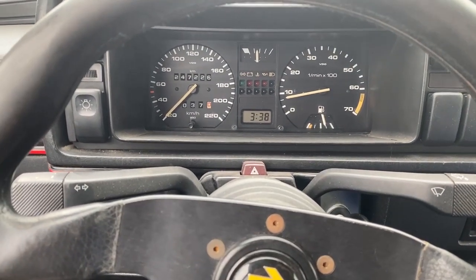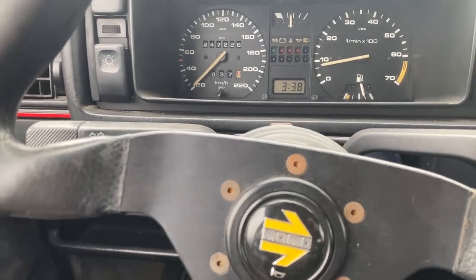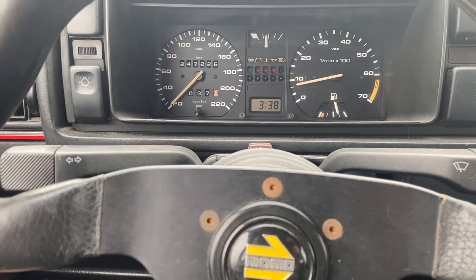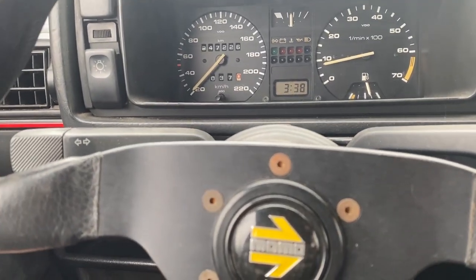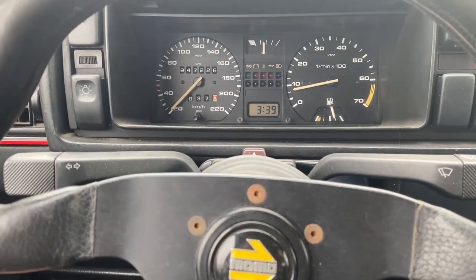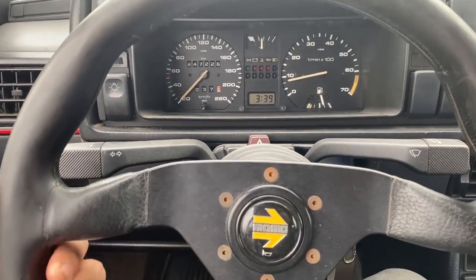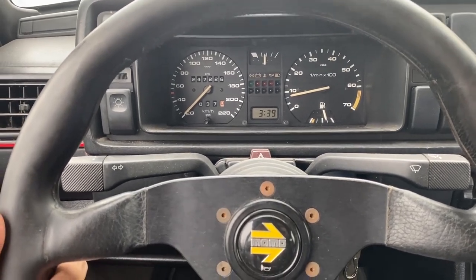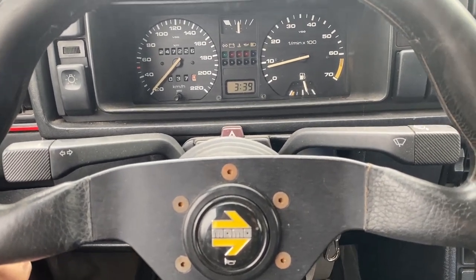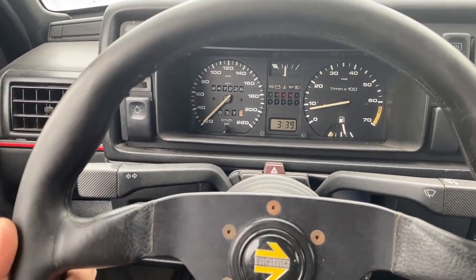So I took her for another trip around the block — it's warmed up and the idle has settled. I think she's fine. I had to add a little bit more oil because four quarts didn't seem enough, so I added maybe another half quart. So far so good, guys. Tire pressures seem a little off, definitely needs an alignment, but other than that I think she's good to go. Brake pedal feels soft — maybe it's because I haven't driven this thing in a while — but we'll go ahead and check brake fluid as well.